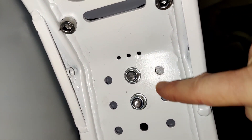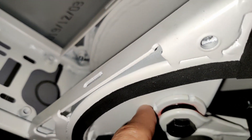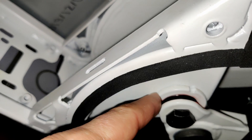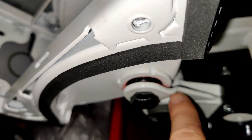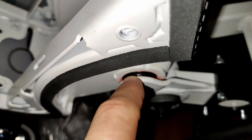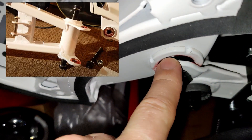I think this plate's different as well. When you look at the frames from the outside they look the same shape, but when you start looking at all the different bits - oh, another bit down here as well where the swing arm mounts. The Chinese frame's got a welded-in tube, but this one's got an insert, which they say is better because it doesn't deform. And also the swing arm on this one kicks out there, and we've got washers in there, whereas on the Chinese frame it's more of a straight arm.